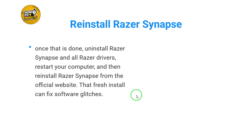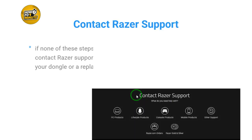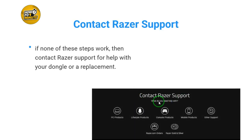Once that is done, uninstall Razer Synapse and all Razer drivers, restart your computer, and then reinstall Razer Synapse from the official website. That fresh install can fix software glitches. If none of these steps work, then contact Razer support for help with your dongle or a replacement.